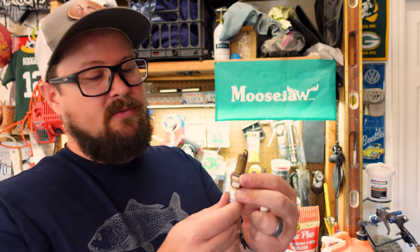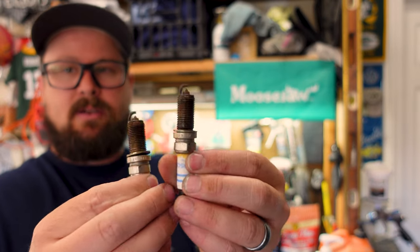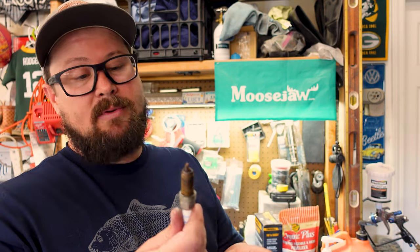I've gone through now and got all those replaced. Went and drove it — everything drove fine, no check engine lights or anything. I did a little research and found that some trucks come with Bosch Iridium just straight from the factory and some come with NGK. I went with NGK — they had really good reviews on all the different Dodge Ram forums for the 6.4. If you're familiar with Bosch and you like it, as long as you've got this little ring seal and it's within specs, I would say go for it. But 100,000 miles is a long time on a plug. You can see these ones here are the worst ones — they came off that driver's side back cylinder. There's some oil seepage going down in there, and these were not very tight.